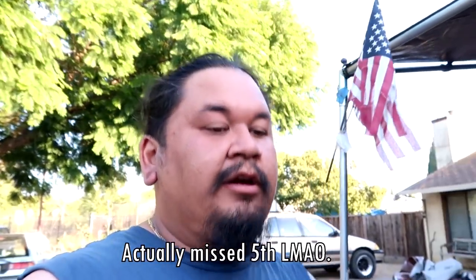Thank you to Redzone for tuning the car last minute, because we had to fly him out from Hawaii, and he was almost able to squeeze 10 cars in the 3 days that he was here. If you guys have seen the track video, the car did an 11.4 at 110 miles an hour, and now I know what I need to do as far as improving this car's performance. The very last pass, I ran slicks and cut a 1.66 with granny shifting second gear and having to go into fifth gear because the transmission is super short in gear ratio.